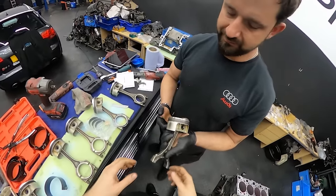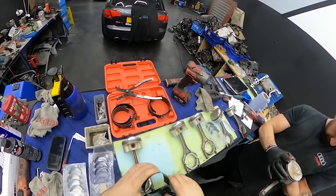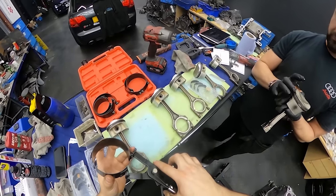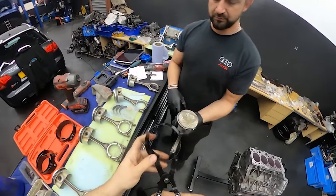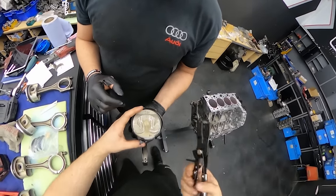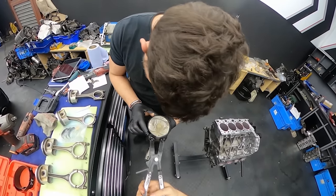Number one. Oily. Oh, it's very oily. Okay, we also need to, did you gap the piston rings at 120 degrees? So it should be split to 120 degrees from one to the other always. That's what the smart manual says. Bottom. Okay, Mr. Bottom. Good. Way too much oil coming up. Okay, I think they're nice and tight.